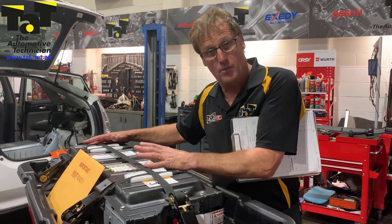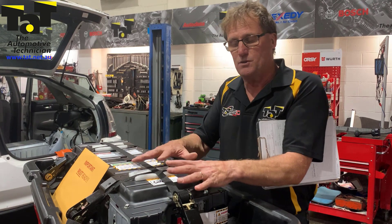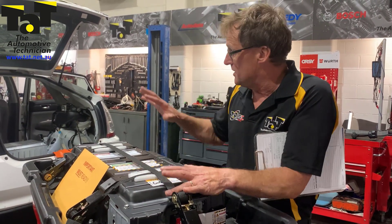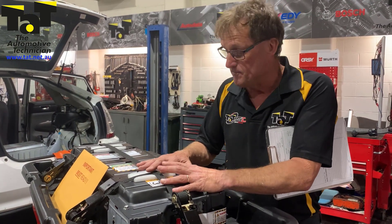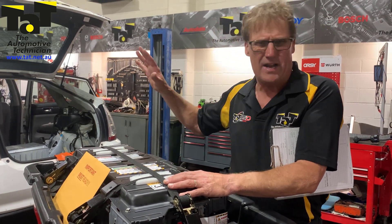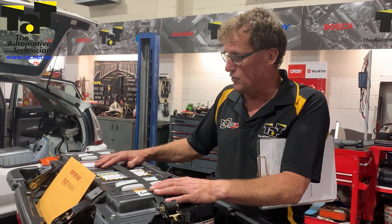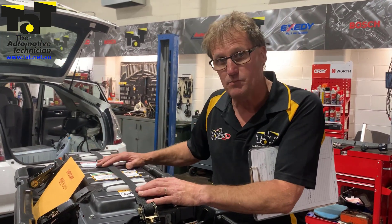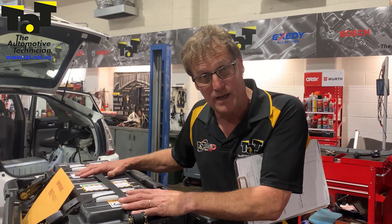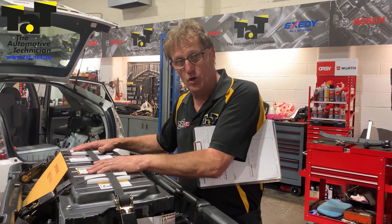Now, compared to a battery pack from Toyota where you buy just the battery pack, this is still a little bit cheaper. But in this particular case, you're getting a fully remanufactured battery management system as well. We've got a fault in the battery management system on top of the battery pack fault, and the vehicle has 160-odd thousand kilometres and is 14 to 15 years old. The customer's chosen this option — the other options were second-hand, which are very hard to find, or a complete battery pack with a guarantee, or just the battery pack without the BMS from Toyota.